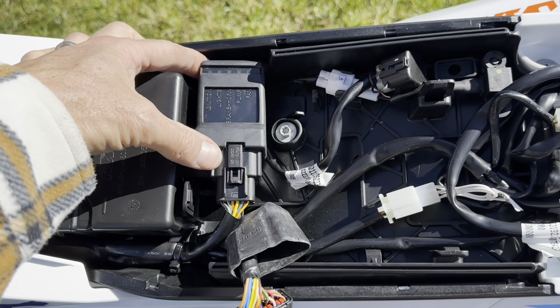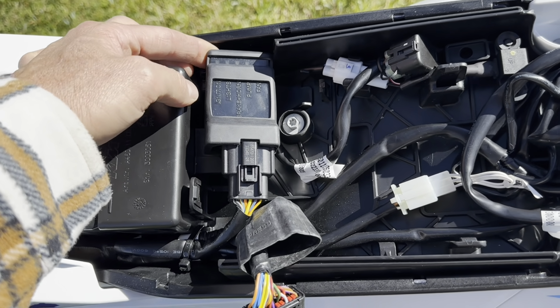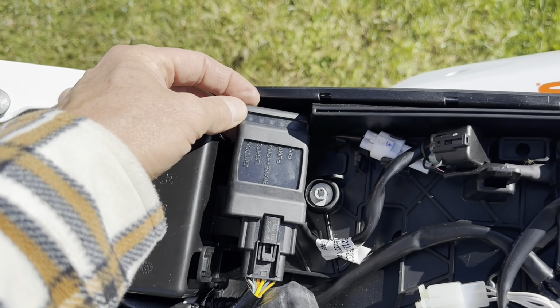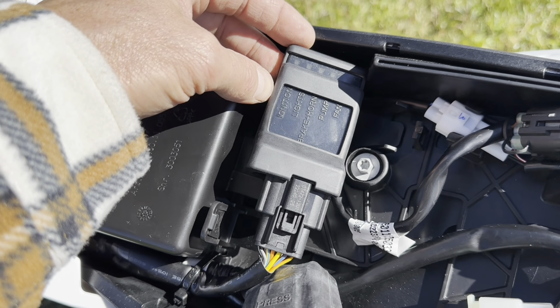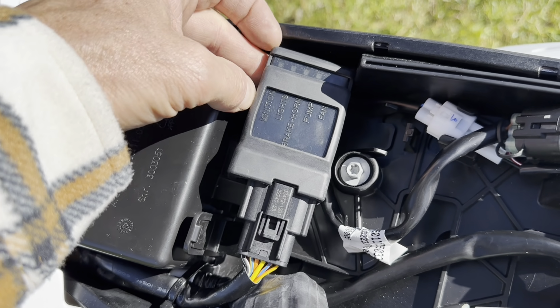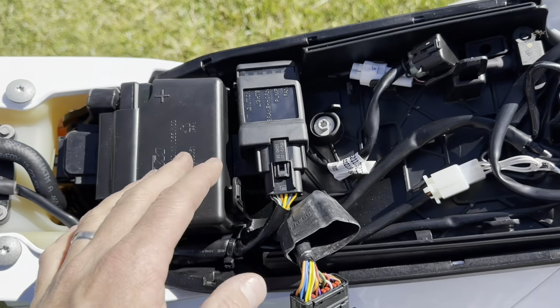And this replaces relays and fuses. You no longer have that. You have this solid state controller where you have function lights that tell you if a circuit is on or off, loop, offline, and you have ignition, lights, brake, horn, pump, fan. So where you used to have relays, you had the little relay block, no longer. You had fuses, no longer. And in its place is this.